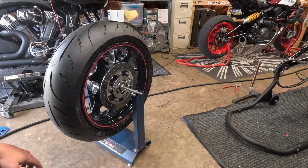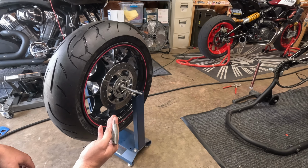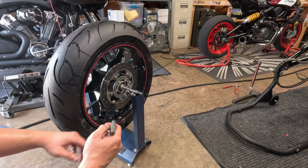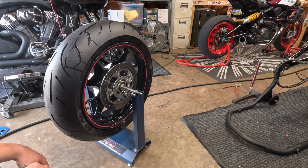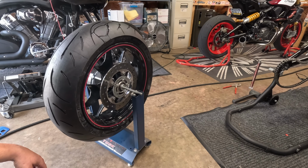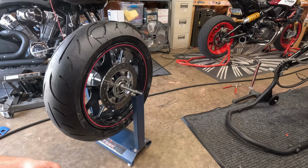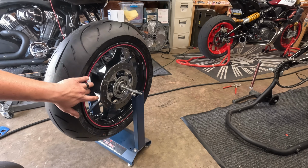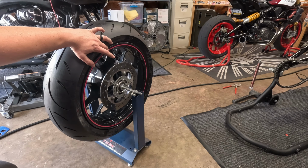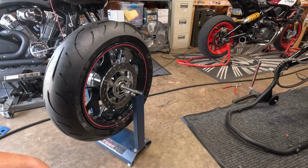So what I may do, so this is still heavy down there. Or is it? See? So if the valve stem area was heavy, wherever I stuck it, it would go back down there to that point. Now is it going to fully go all the way back down there versus going all the way up? No. So right now, what's showing, this is the heaviest part of the tire. So theoretically, if I take this part of the tire and stick it right there, is this going to go back down to the bottom, right here? Slowly but surely. Or will it stop?